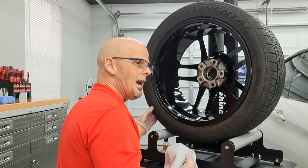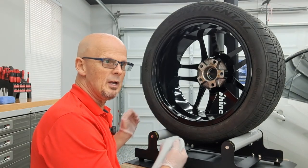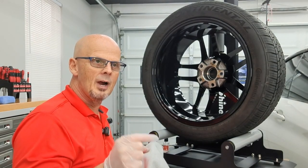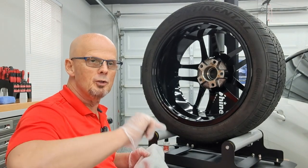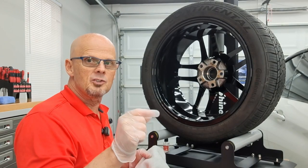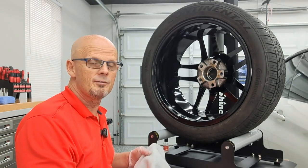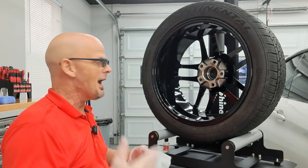There are some coatings that are highly solvent based that if it says use 1 coat, you need to use 1 coat, because if you do more than one, with it being a high solvent base, you put 1 coat on there. Solvents are used as drying agents a lot of times. If you use a high solvent based coating and then you go back and put a 2nd coat when it says 1 is enough, you're going to diminish that 1st coat because the solvent itself will begin to break down the coating. Okay, so if it says 1 coating is sufficient, more is not better. Okay, stay with the 1 coating. You don't want to take a backward step in that.